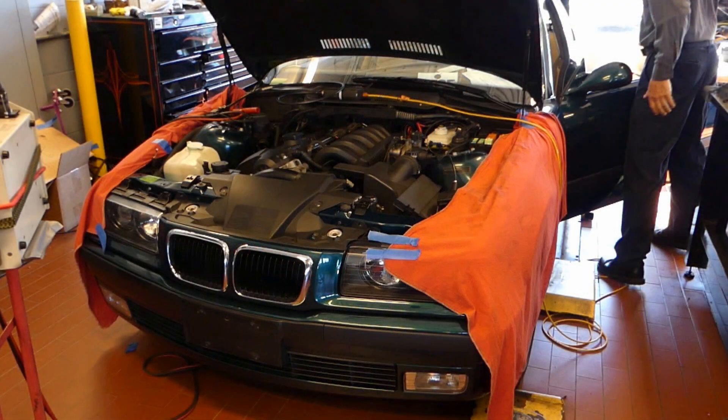A couple of days later I brought the engine and all the other driveline related parts to my technician and he installed them. Just prior to this, we had been turning over the engine with the fuel pump fuse removed to help prime the oil pump. Unfortunately, during all that cranking we did not notice the oil pressure light go out, so we decided to reinstall the fuse, turn the key — and this is what happened.